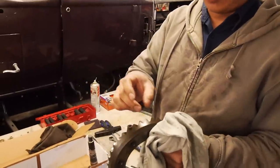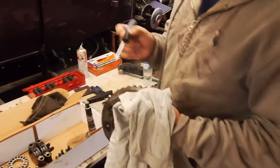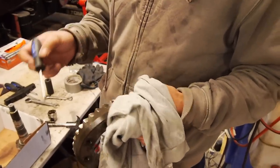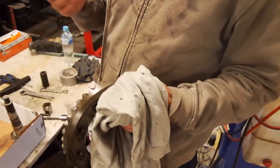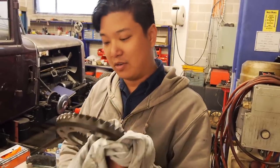But what happens is, it's a certain diameter, so if you increase the number of teeth, the teeth get thinner through here, which is the root. That's the root. So this gets thinner to fit the more number of teeth on the same diameter gear. But the Nitro gear set, they choose one step down, so you have less teeth, which means it's slightly noisier, not that you'd notice with all terrains and all the rest. And it makes the teeth wider at the root, so they're a bit stronger. So that's a good thing all round.